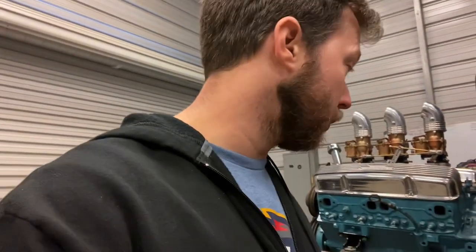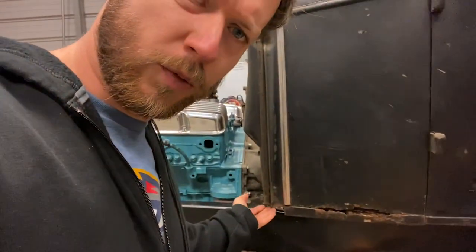Start tightening at the front, because I ran into a problem. I welded these fronts on, and they weren't high enough. So I had to go back and pie cut and push that piece up and then weld it again. I need to come back and smooth it out once the body comes off for paint.